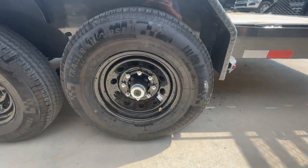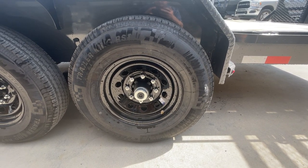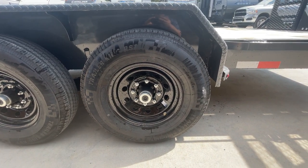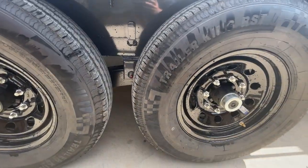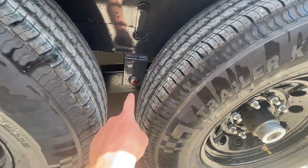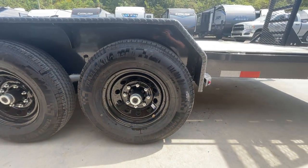Black mod wheel. It's got a 7,000 pound axle. Lamar does use an upgraded 9/16-inch stud, so it's going to be a 7/8 lug nut. It's got a 235 80R16, 10-ply load range E radial tire. When you go to the 14,000 pound GVW, you go to slipper spring suspension — pretty well industry standard — which not industry standard would be the wet bolt kit they put on there for some extra serviceability.